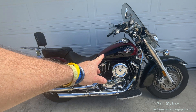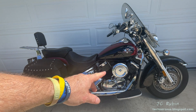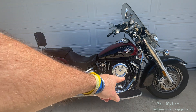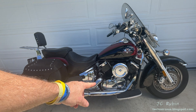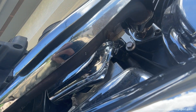Hey everyone, people have been asking about the LM2 computer kit that I've bolted onto this 1100, and some old YouTube videos have been getting a lot of requests. So today I'm going to bolt that kit onto this bike and go through an entire session with the computer, analyzing all the exhaust gases coming out of these pipes for carburetor adjustment, needle adjustment, and jet adjustment.